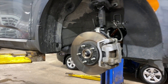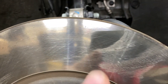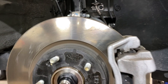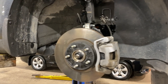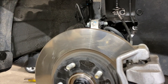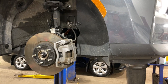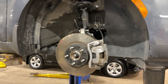Now we've taken the wheel off. One of the cool things about EVs: you can see diagonal lines — cross-hatching — on my brake rotor. You wouldn't see that on a gasoline car's brakes at the first oil change, and this car has 16,000 kilometers. That cross-hatching is still there because the front wheel brakes aren't used that much on an EV — you have regenerative braking, where the electric motor brakes the car on the front.